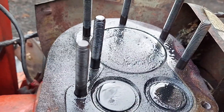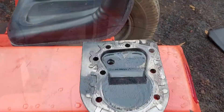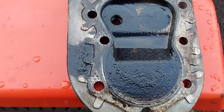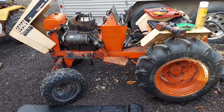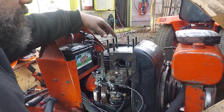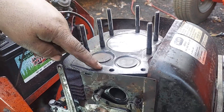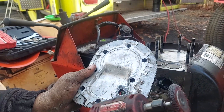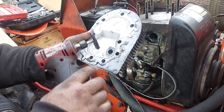Stick a rag down in the piston hole to keep some of the debris out — you'll get some in there but wipe it out and clean it. Here's a picture of the head soaking. We've seen much worse, but this isn't great either — it definitely needed to be done. We cleaned up the combustion chamber, the valves, and the piston — all nice and clean. Make sure you clean your gasket mating surface for the new head gasket. We use nylon bristle brushes on die grinders. These Milwaukee quarter-inch grinders are awesome, especially for gasket prep and decarbon cleaning.